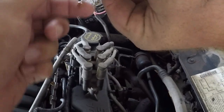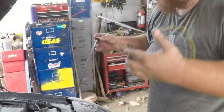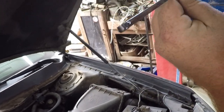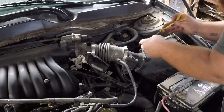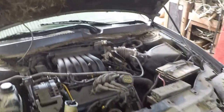Let me see that. Yeah, let me get in there. Really clean. Fresh oil. It's got good viscosity to it. And tastes good. Breakfast. Tastes good. Transmission though. Oh, not too bad. Still pretty pink. It doesn't have any water in it, so it's a good start. On the fluid side, it's not doing that bad, but on the suspension side though, need some love.